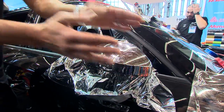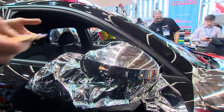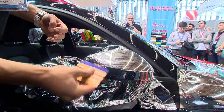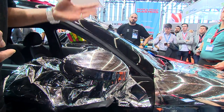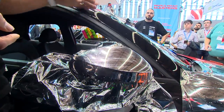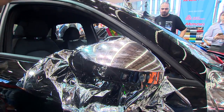And now that we have it here, how quick was that? Okay? Because we're working as a team. And then we spray our squeegee with soap and water, and then we apply it. This is only when I squeegee here. But again, we're using either a steamer or an IR heater, and we're wrapping it together. Okay? There's times where I've literally wrapped the antenna of a car with 3 people. I've wrapped the bumper of a car with 4 people. But you wrap the bumper of the car in like 4 minutes.